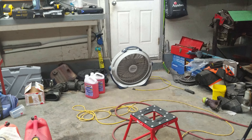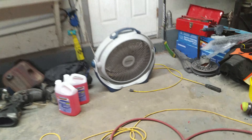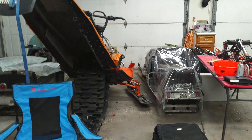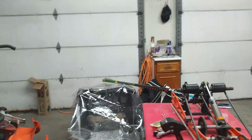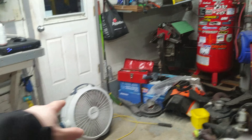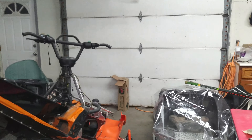The other big thing if you're doing it like me, working out of your garage, is airflow. It's very key after you're done painting to get the air flowing — you want to get those particles out of the garage. So in my case, open up the doors, turn the fan on and let it blow out. It clears the whole room in probably 10 to 15 minutes. That's huge, and it's something that always gets overlooked.